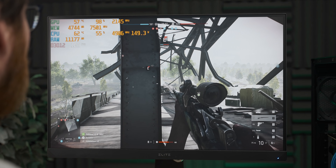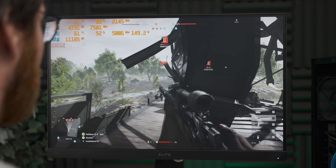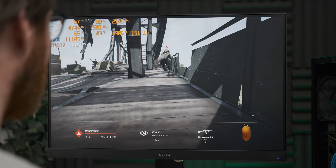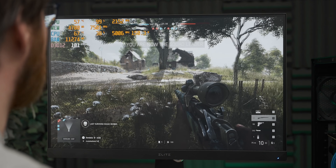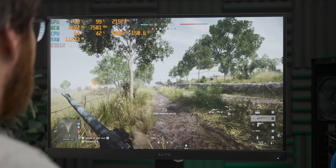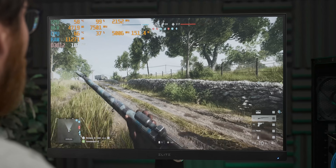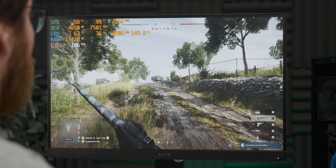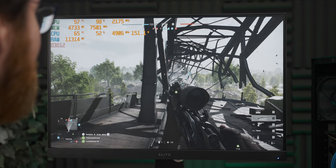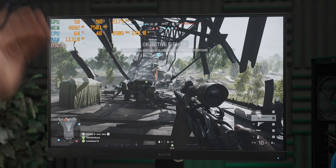210? 2145 megahertz — there hasn't even been a mild hiccup yet, it's just trucking along. Let's try another step up. We're at 2152 now. It did briefly hit 2160 and there didn't seem to be a problem. This is going well. I think we're going to be able to get a reasonable performance jump out of this card. Damn, I think we may have potentially won the Silicon Lottery with this 3060, and we're still not over 60°C.